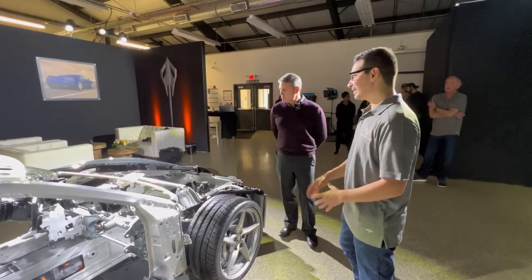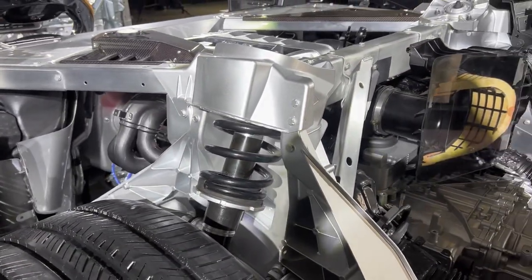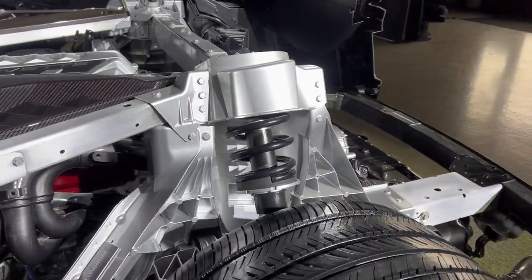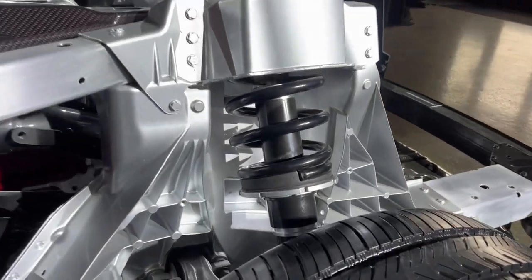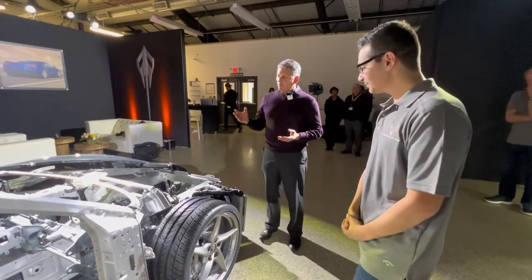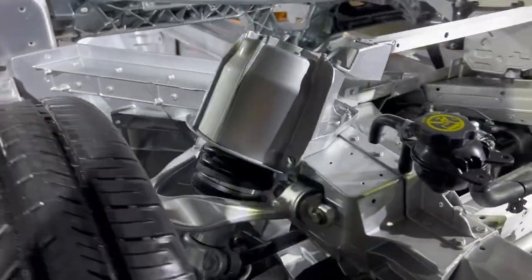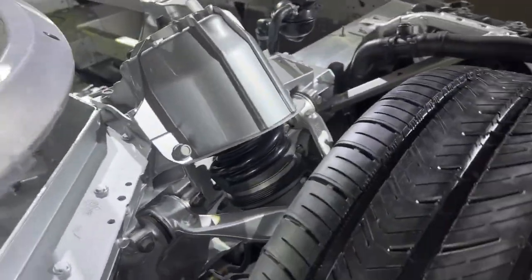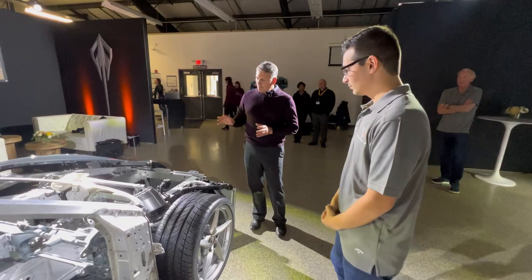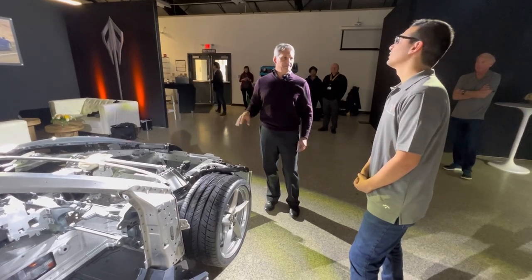And then like the spring rates — it has MagneRide 4.0 from the Corvette. Are the springs different compared to a Stingray or Z06? We add mass, and every pound had to earn its way in, so we have to accommodate that mass. This vehicle has what we call our FE5 suspension — it sits right in between the Stingray suspensions and our Z06 FE6/FE7 suspension. The FE5 suspension unique to this car has a little heavier springs, primarily in the front, where we accommodate that extra mass. And we get MagneRide tuning unique to this model as well.